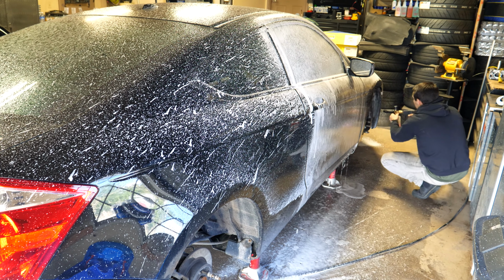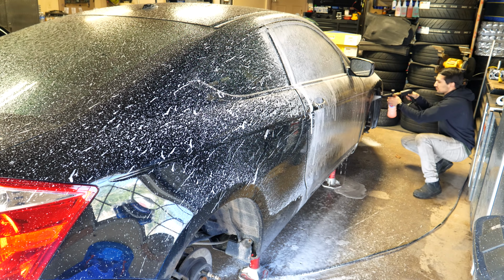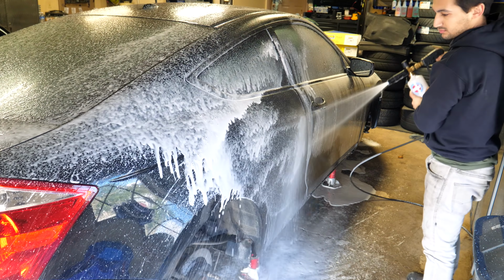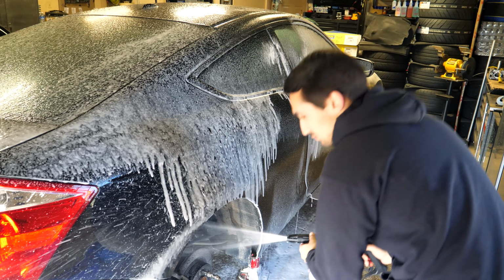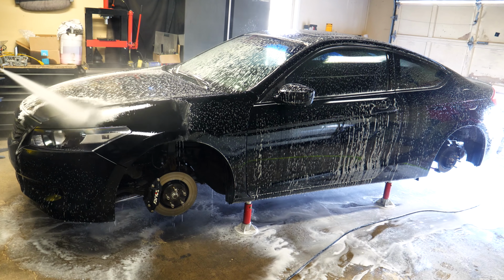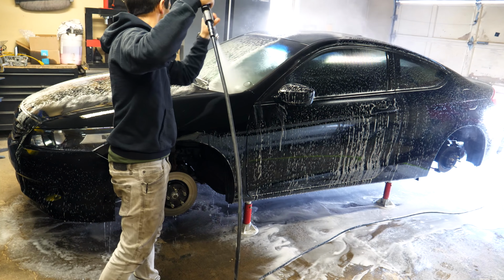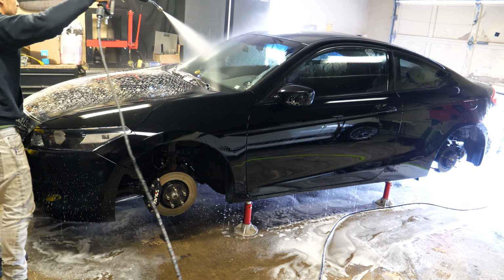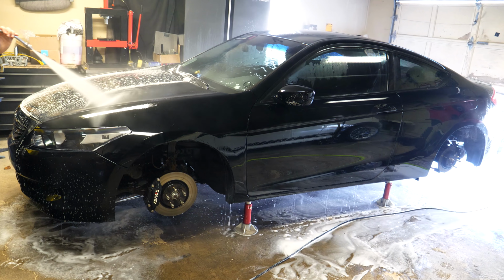Oil spraying the bottom side of your car isn't a half bad idea too, but that's going to be for a later DIY. Let the soap solution sit on the car for a couple of minutes to allow the soap to really penetrate into the filth. Then, working from the top down, rinse down the car with the same pressure washer, but without the foam cannon attachment.